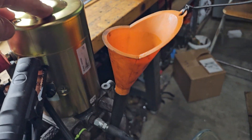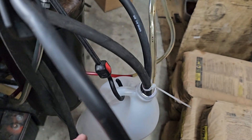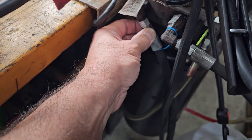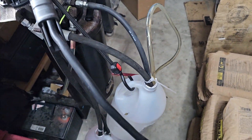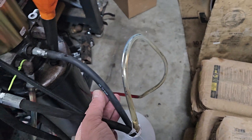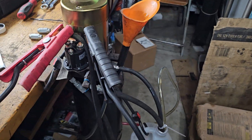It's a direct link. This will help some of your RV techs out there too — trying to keep these old girls going, there's some classics out there. That's the electric motor; the hydraulic pump's down inside. I hooked up some hydraulic lines, made some buckets. From experience, I know that this one and this one are outputs — they're going to go into here. These are from the device, like the legs that would push up, or the slide that's coming in.